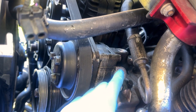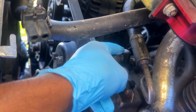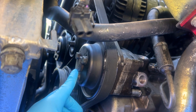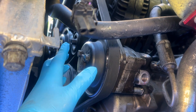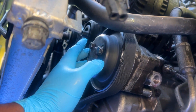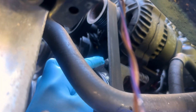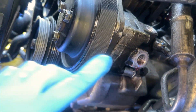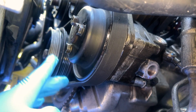In order to take the power steering pump off, you have to remove these lines — it's a 19 millimeter at the top. Once you take those off, next up is taking these 13 millimeter bolts off for the pulley itself. It's easier to do it while it's here. There are also two bolts at the top, two 13s — this one right here, another one on the left of it — and one more bolt back here.